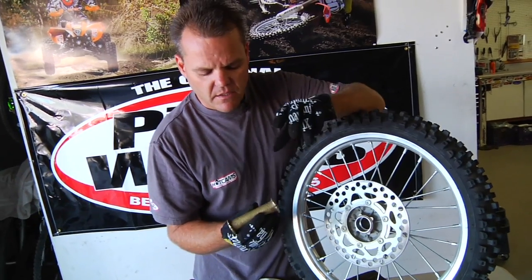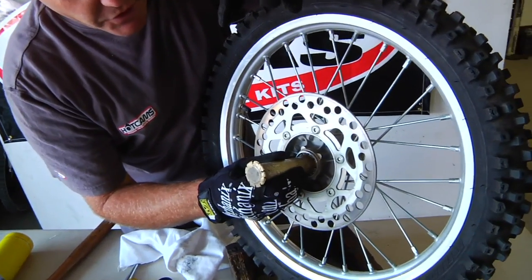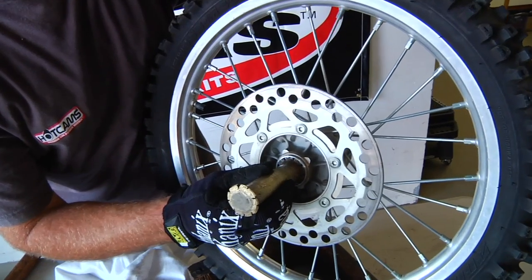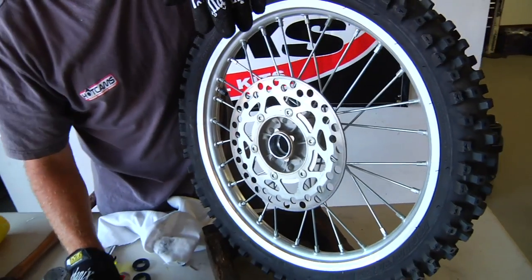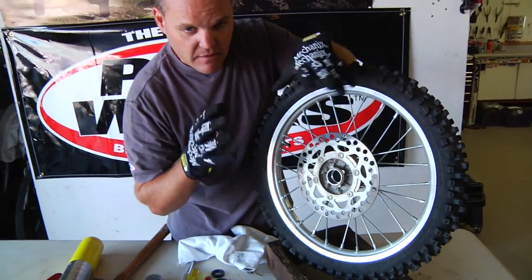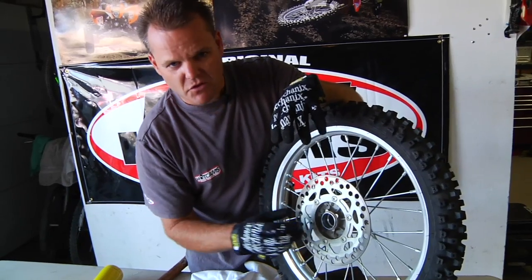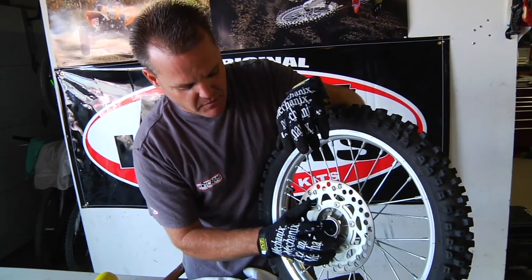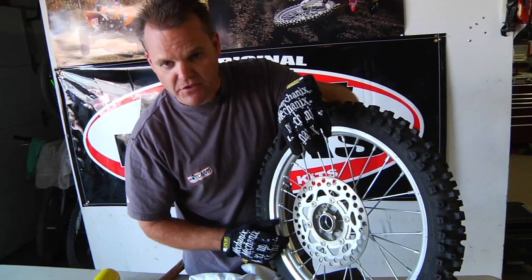It's nice to have something solid — I have a piece of brass laying around, but you could use a socket. You want it just big enough to get right in the hole so we can knock it in. If you have a press, that'd be ideal, but sometimes if you're off a little bit, you could actually break the hub. So it's a good idea to just heat it up and put the cold bearings in. Sometimes they'll drop most of the way in and just a little tap and they're seated. We'll heat it up and show the reinstall.